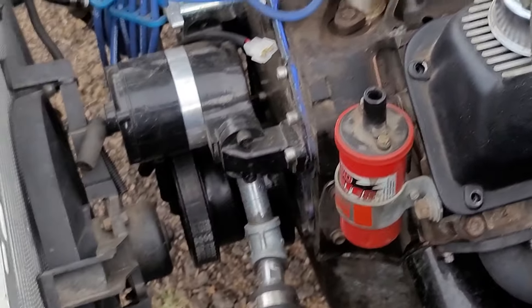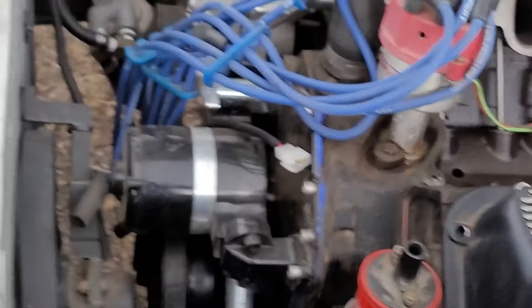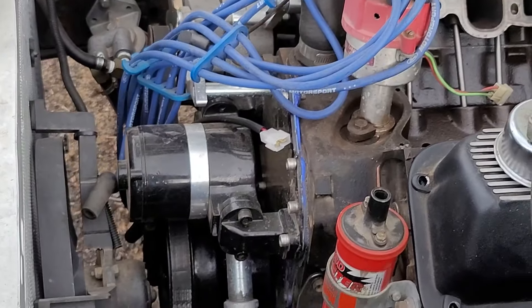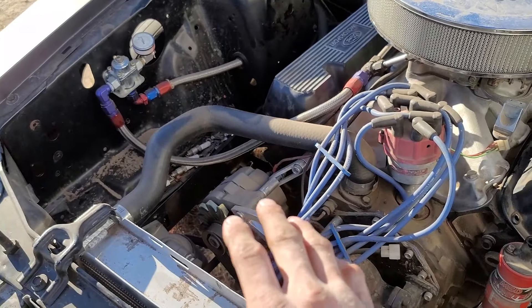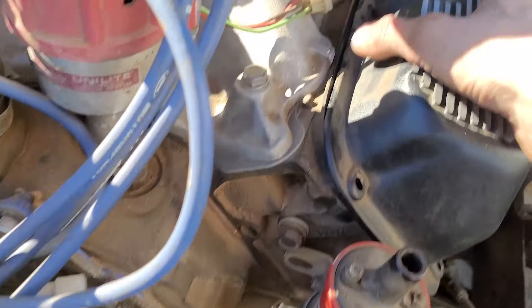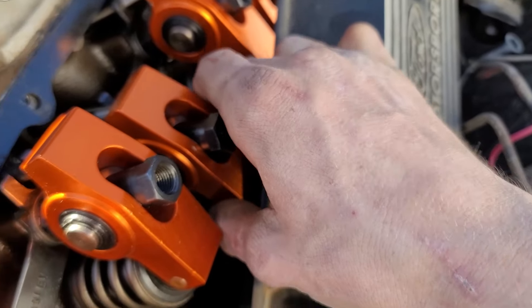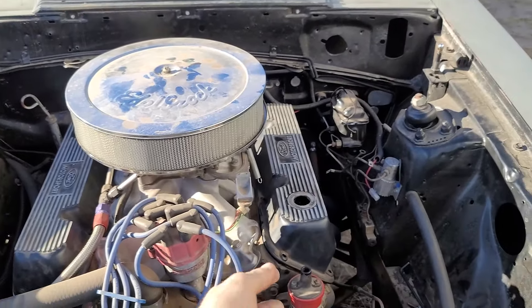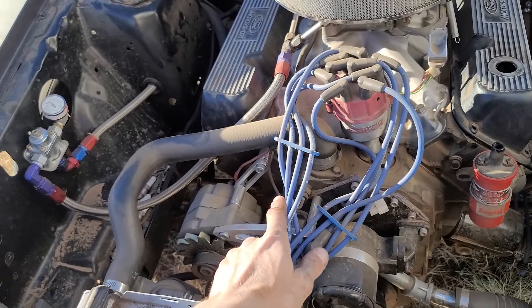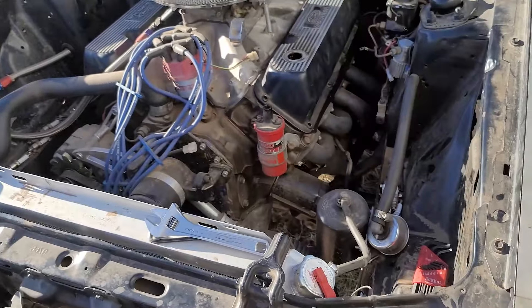I just don't know if it's leaking coolant because of the blown head gasket. If it does leak I'm gonna have to pull the whole front cover off again — that'll be like the fifth or sixth time I've done it. Sorry for the wind noise, it's very windy all the time here. I just finished the lash adjustment — you want to get it to where you can move it side to side a little bit but you can't move it up and down, then you've got a good adjustment. I'm gonna finish putting everything back together — wiring, spark plug wires, spark plugs — and it seems to be all good. We're gonna go take this for a rip real quick.